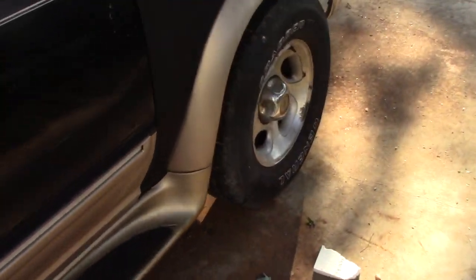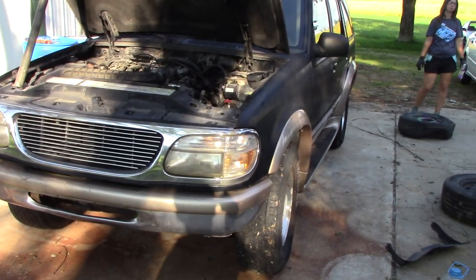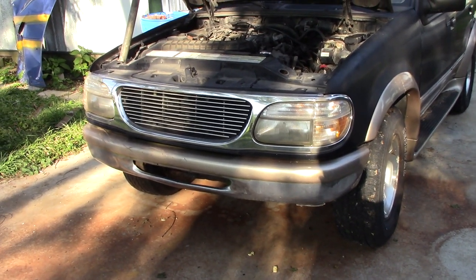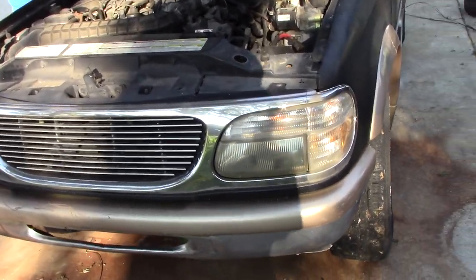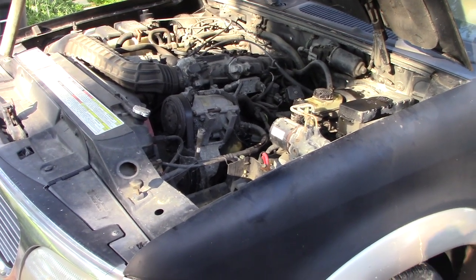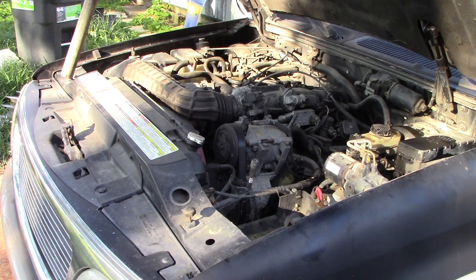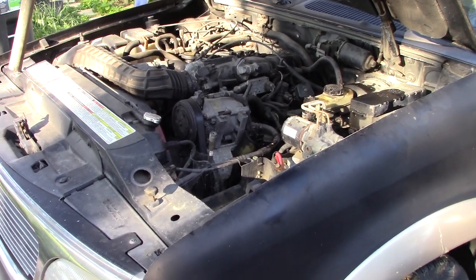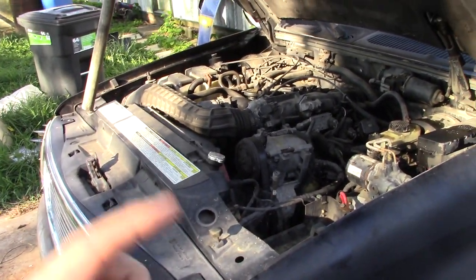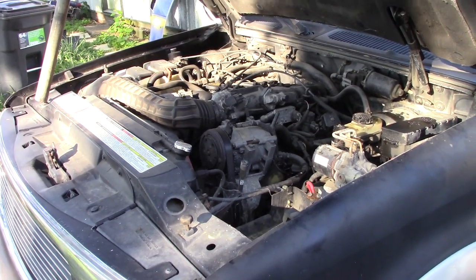The front has street tires, which is fine — they're steering tires. As for what we know about this vehicle: the owner said the fuel pump was out, and that I have confirmed. The simplest trick for a fuel pump test — jump it and spray starting fluid down the throttle into the motor while cranking. If it fires off and then stalls back out in a couple seconds, the fuel pump's probably bad because your spark and ignition are all working. That's exactly what this thing did. It fired up with no ticking, no knocking, running on all cylinders really smooth, and sounded pretty darn healthy.